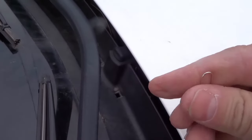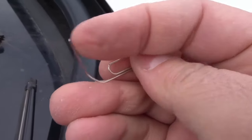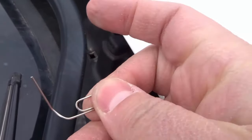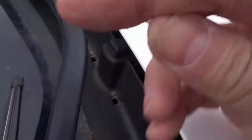And if you pierce through the hose, then you're going to have a leak in it. So you just want to go very gently in there. And that's also why I choose to use a paper clip instead of a sewing needle or a safety pin, because this has less of a chance of puncturing that hose of your windshield washer fluid nozzle, just because it's not nearly as sharp. You don't want to use anything that's super sharp.